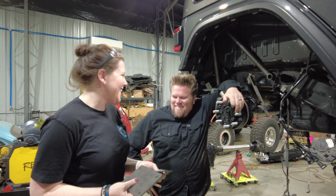I don't think it needs it, but I'd feel more comfortable with it. And then the whole point of this is, what'll happen now is this other piece, this shock mount that Holly held up, we have one in here now. This is now tacked to the plate, and the shock mount is tacked to the plate. So then what we'll do is we'll take these tubes out, we'll push these little pieces out, we'll take the screw that's holding the roll cage plate out, and we can take this entire shock tower out, build it on the bench, and then put it back in. Pretty cool stuff. And then we have to do it again on the other side. And then we're like a tenth of the way done with our work today.